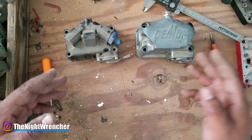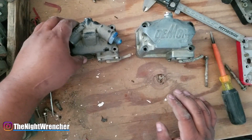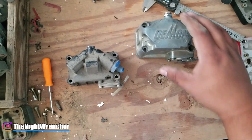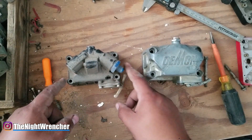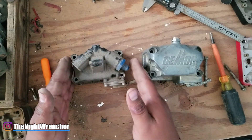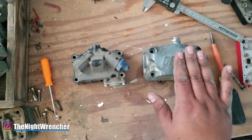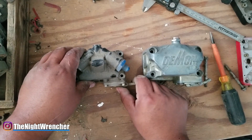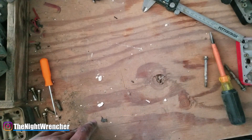Although the extra fuel volume does affect the specific gravity of the fuel, it won't really mess up tuning since I'm going to be tuning everything individually anyway. So I won't be running the standard HP fuel bowls. They do sell center-hung float bowls in the HP or XP style that are longer and deeper than the standard Holley ones, actually similar to the Demon bowl — but they cost more money, and I already have these parts, so I might as well use them.